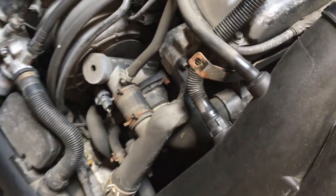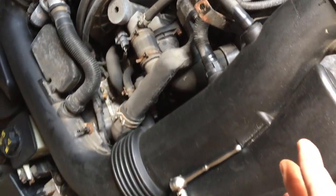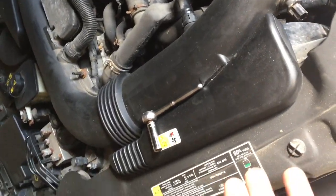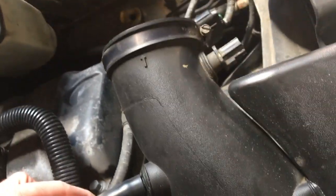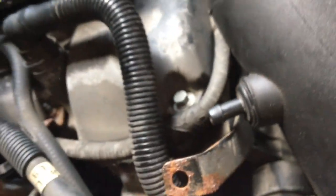This piece kind of gets in the way when you're doing a lot of work. You can work around it most times, but if you're putting in a new thermostat — which would be in this housing — you can remove it without removing some of this stuff, though it's just a lot easier when you do it properly. Also, when you remove some of this stuff you can get in and clean your throttle body, which we'll get into in a bit. This hose right here just pulls right off.